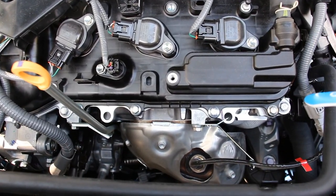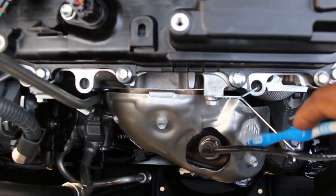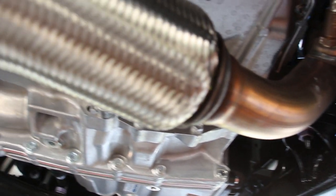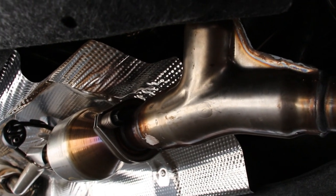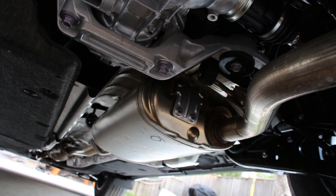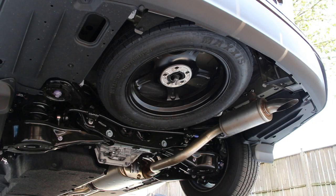Next we'll take a look at the exhaust. Because this is naturally aspirated, we've got the front bank here with an integrated manifold that goes directly into this catalytic converter, and then there's the same thing on the back. That exhaust travels down underneath the engine through this flex pipe and then joins up with this Y-pipe with the exhaust coming off of the rear catalytic converter in an L-shaped design coming off of the rear bank. After the Y-pipe it then goes through another catalytic converter and out the tailpipe to the muffler. The exhaust then travels to the middle part of the vehicle where you've got your main muffler, and then it travels through a small little muffler and out the tailpipe. And now we'll have a listen to the exhaust.